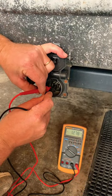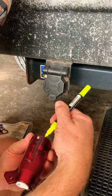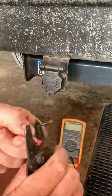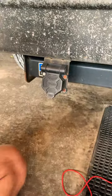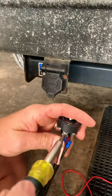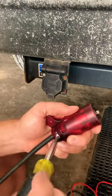So I got my meter out. I found the ground and the auxiliary power that always stays hot. I'm going to mark those two and we're going to hook them up to those contacts. I'll just go ahead and strip my wires back and use these inexpensive crimp-on spade connectors because I got screw terminals and they work great. Great contact, and I'm just using a seven prong trailer plug.